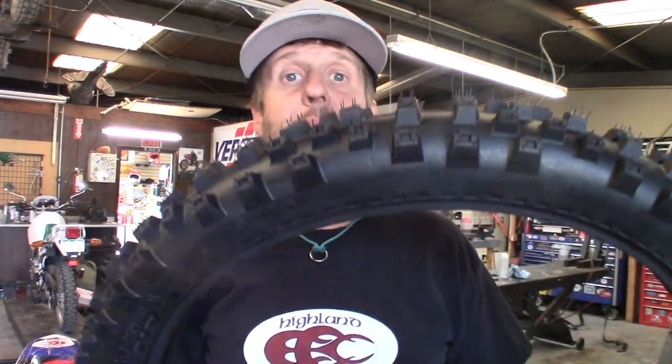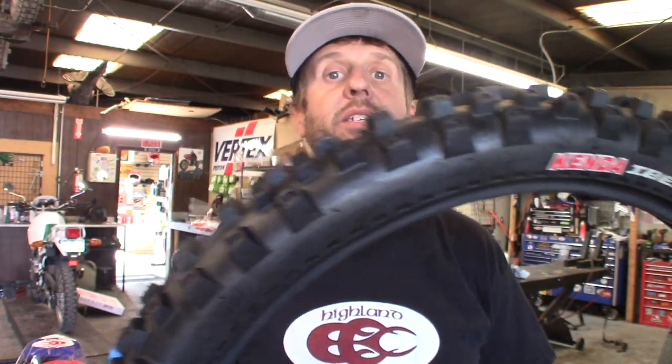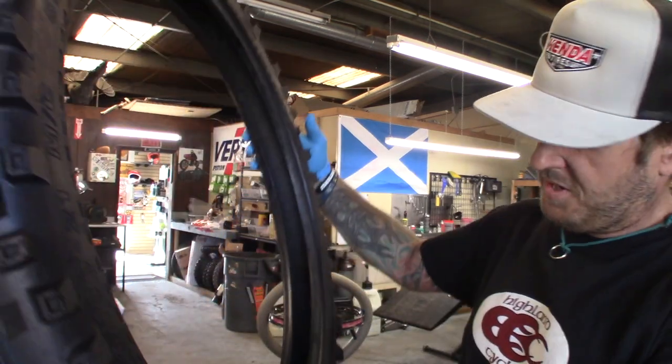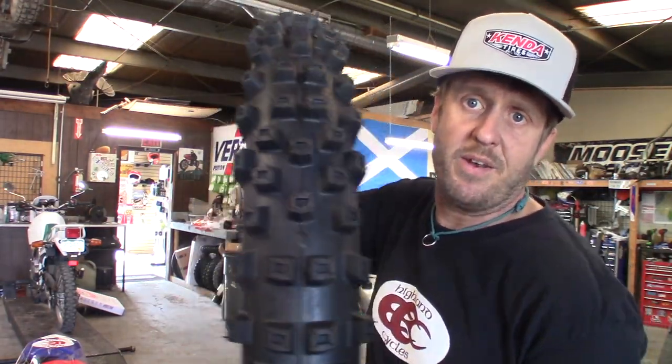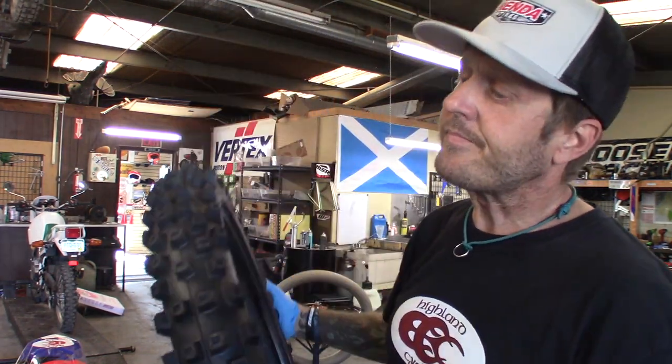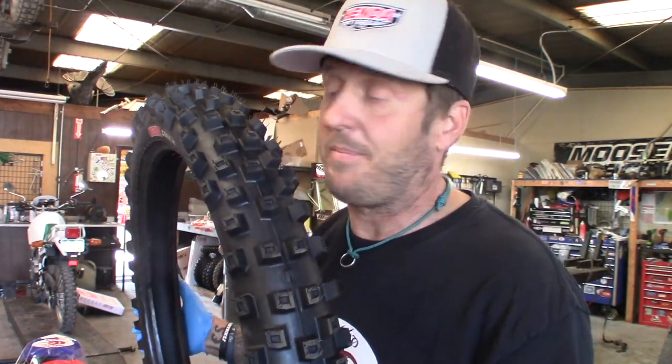Now let's talk a little bit about the Ibex tire from Kenda. This is the front tire — it has a rotation direction on it, and you can tell it is asymmetrical as far as the way the pattern is; it would definitely work better one way than the other. This is one of their hybrid tires, so it's a super soft compound but with grippy big knobbies. Obviously made for hard enduro, enduro cross, things like that. I've never run a front one — I've run a rear — so I'm pretty excited to try this thing out. The best way to do your mousses, for mess's sake, is to put the lube inside the tire, and then I also put lube on the mousse because it helps it go in.